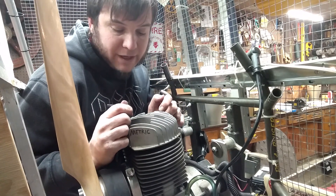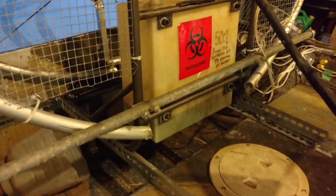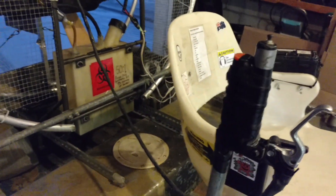I just need to torque these down correctly and get a new spark plug. I've come back in and replaced my spark plug. I've also replaced the fuel filter — I had a smaller one, I put a bigger one on now — and that should finish the basic tune-ups for this engine. I've thrown a little bit of gas in my tank, this is 95 octane with full synthetic oil, and I've gotten my rudder system hooked up again. You can see when I move the stick, it wiggles my little plywood rudder, and my stick also has a starter button, a kill switch, and the throttle.